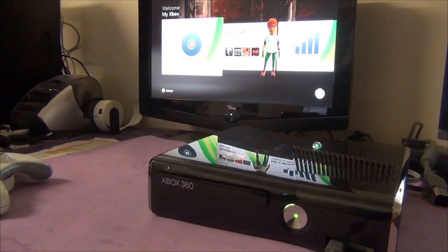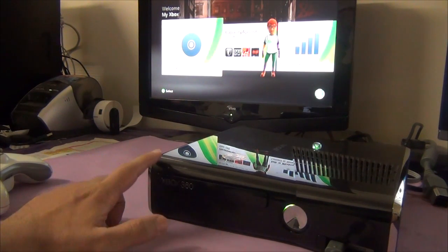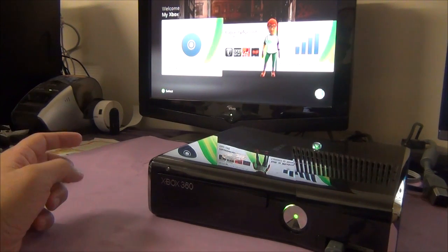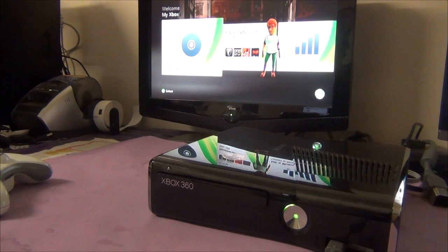In this video I'll be showing you an example of an Xbox 360 Slim broken DVD drive. I've got the Xbox 360 on. It's got this constant flashing light. I'm going to eject the tray. It doesn't eject. Obviously you cannot insert your disk. It doesn't read disks. The drive's gear and motor assembly is completely broken. In order to fix it, the best, easiest and cheapest option is simply to replace it with a brand new drive. Okay, let's get going.